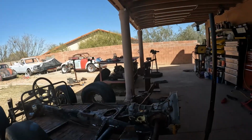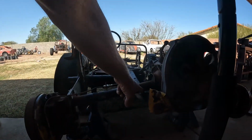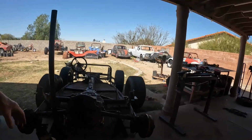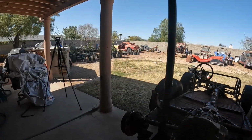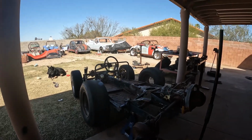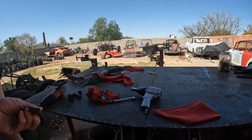Well, good morning, guys, and it is the next morning. I am now working on putting a little plate in here to get a little bit more room for the axle boots to get up underneath here. So, got the wheels and tires off and got it all jacked up on jack stands. What I need to do is now compress that suspension. So I can see I got some, this is 3/8 plate here, flat bar here. Cut little sections of that off and stick it there, but let's get an idea how much that's gonna lower that suspension there. So let's do this.